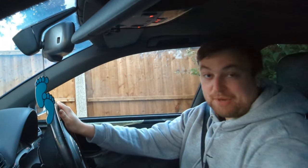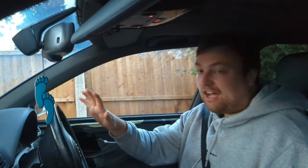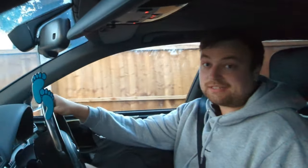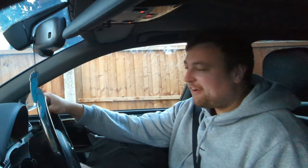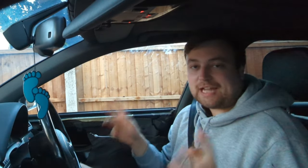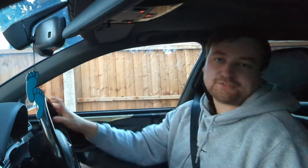This is the reason why it needs one. Put it in first gear — the car's always shaking, you can probably hear that now. Better to clutch up. See what I mean? It's very, very juddery. Clutch juddering, whole car judders. I've checked the transmission, doesn't seem to be that. Drive shafts all seem fine, so we're pretty convinced it's the flywheel.